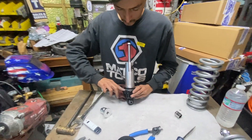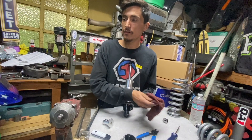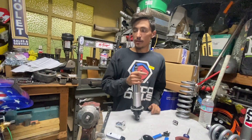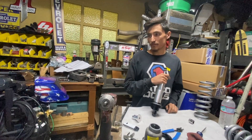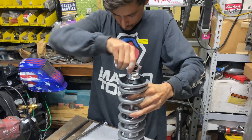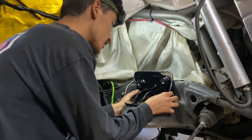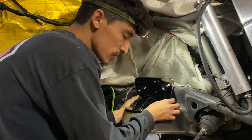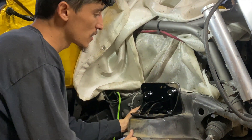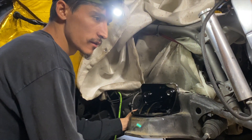After these, the next step is to cut off the other side. I'll probably have to pull the steering link just so I can get the cutting wheel in there, then grind off those rivets, pop that out, and plasma cut a hole so the coilover will go through. I think I'm going to weld those brackets on, but I'll bolt it all up first before I weld just to make sure everything looks okay with how my frame's modified. Cut this out with the plasma cutter, then go back and weld it all. That way we know we're solid.